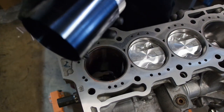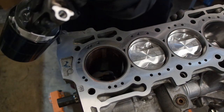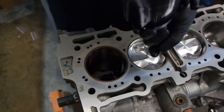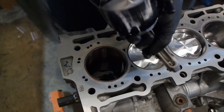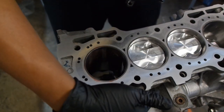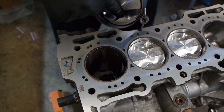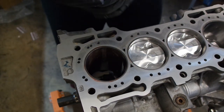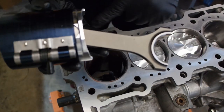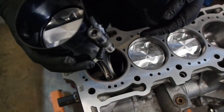Now that we got the piston in the tool, something important: you want to make sure you know which way the piston goes in. My pistons are marked with the intake side, so you want to make sure you're putting the piston in the right way. Mine — this is the intake side, and I have the intake indentation right here. So you want to make sure you put the piston in the right way. You also need to look at the bottom part of the piston exposed and lube it up with either oil or assembly lube.